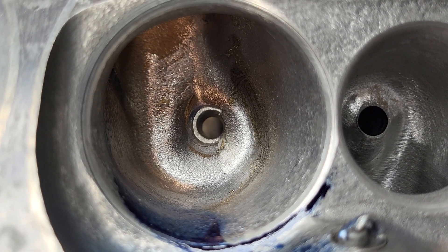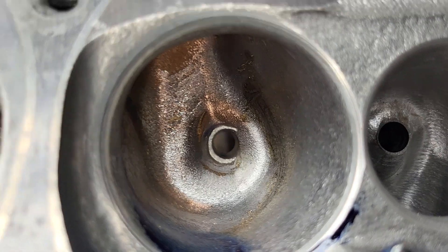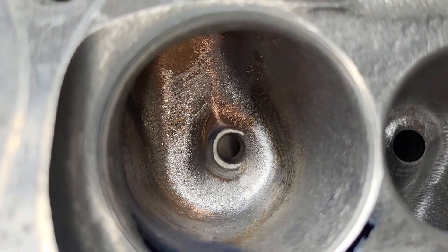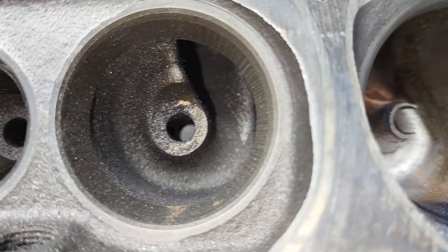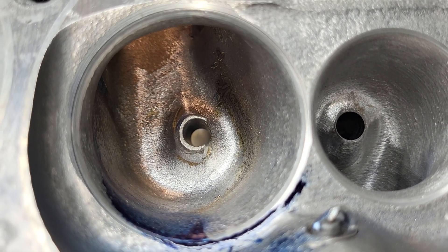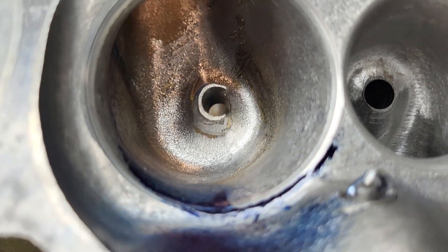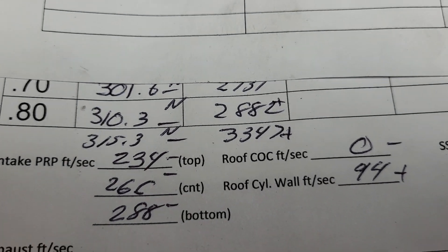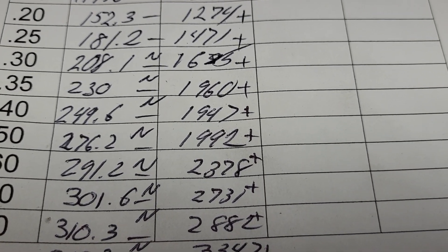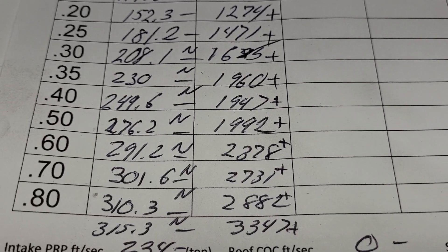So what did we learn? We did learn something about taking an original design and altering it. Even the one that flowed badly — this cut here maxed out 315 CFM. The noise is interesting: I put a flow ball on the floor and the noise didn't go away, so it may not be the short side. It may be more of what's going on on our roof where our airspeed dropped to zero.